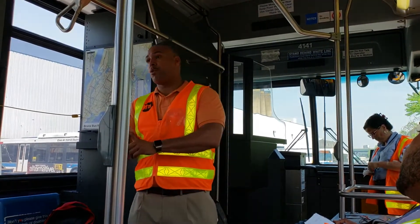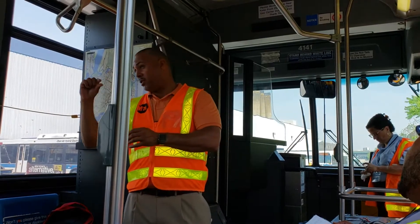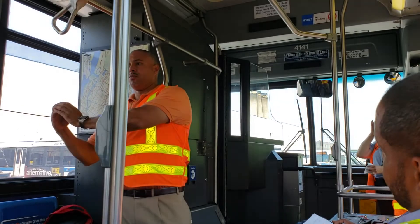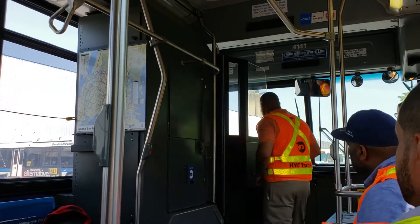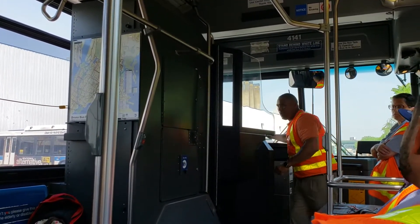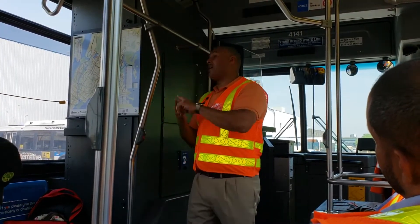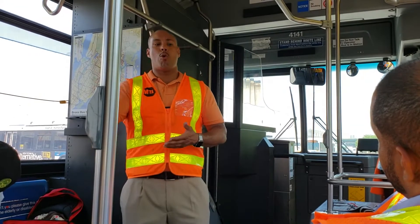Below it, my fire suppressant is secure. My fire protection panel usually says system is okay with a green light — let them know: system is okay, green light. Then on the right corner, you have the wheelchair buttons. You have the test button, the kneel, and the step well heater — three buttons to check here. The test button for the tell-tale panel, the step well heater, and the kneel. Everything else you really can't check, so it doesn't make sense wasting time.